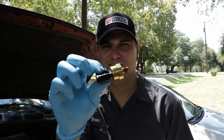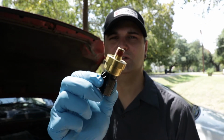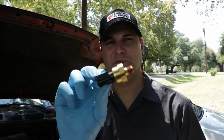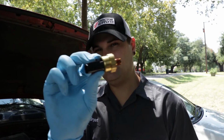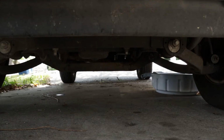Also going to change this guy out. This is an oil pressure sensor. The red little oil dipper light keeps coming on, but it's very intermittent and only comes on for a few seconds. If there was actually lack of oil pressure, it probably would stay that way. So about 90% sure that's what the issue is. Got this on eBay for like $20. So, easy fix. Hopefully.